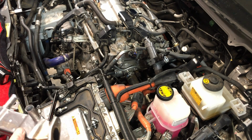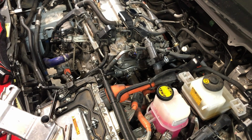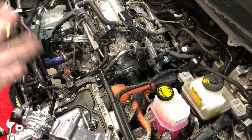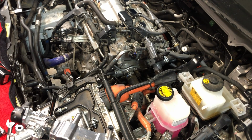You don't want it to be, because this is so critical, guys, to your head gasket not going bad. 5,000 mile oil changes, servicing this every 75 to 80,000 miles, and cleaning the intake manifold at the same time. Doing that, and the oil catch can really helps too. You guys do those things, this head gasket will not give you issues. And this is not terribly difficult. In fact, the first time is the worst, because you're going to have to deal with the bolt from hell.